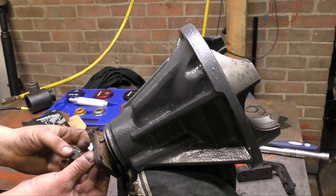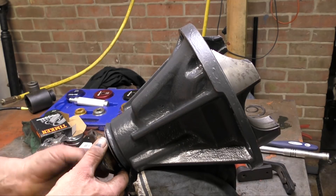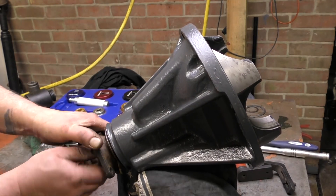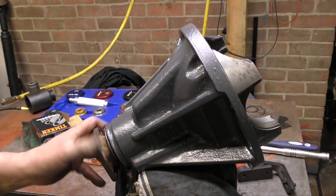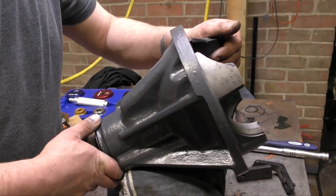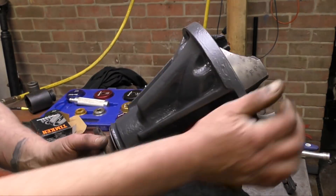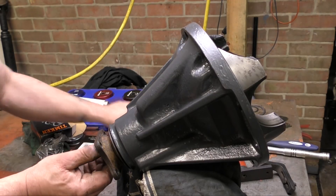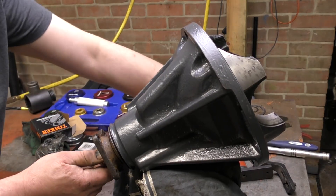Because we're not putting a preload spacer underneath the nose cone bearing, we're not torquing this up fully — we're just nipping it up until we've got resistance on the flange. It feels a little bit stiff to turn the flange, which would be just pretending we've got a preload at the moment — it's just pulling the bearing down. What we have to do now is check the pinion head height, which we're going to do very shortly. I've shown you how the bearings are fitted, and the preload we will set later.